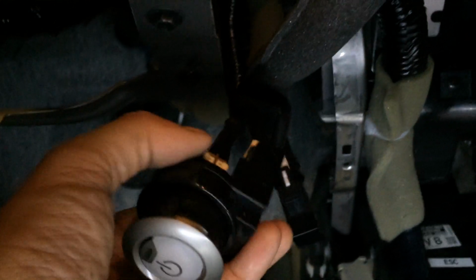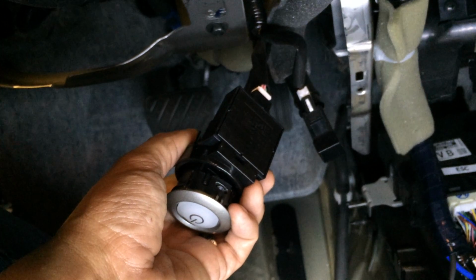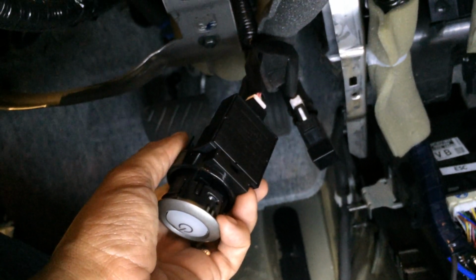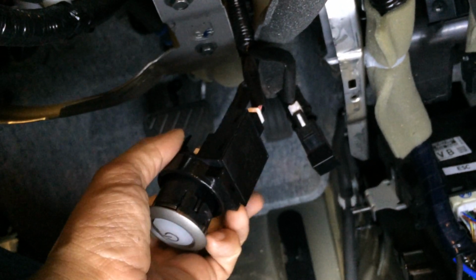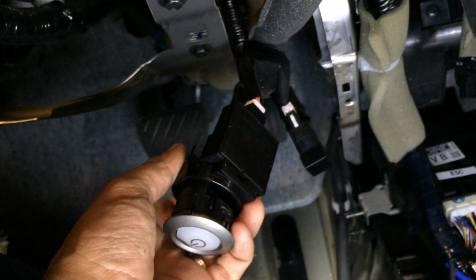And then we've got the power switch here, and sitting on the side of that is actually the NATS amplifier, which is essentially a backup for the smart key system. So if your battery is dead in your smart key, you just hold up the key right there, and this will excite a passive RFID sensor in the key and still allow you to start the car. So that's handy. Then coming over to the passenger side here, you can see we've removed the passenger airbag.